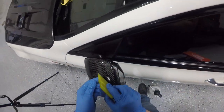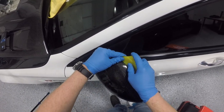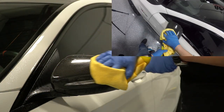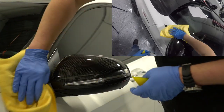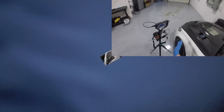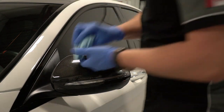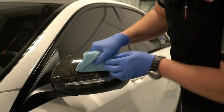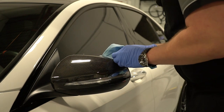There's a little finger in there that I didn't like — there we go. I'll take the microfiber and dry off the top side. With the shop towel, I'll take the squeegee, fold it in half — this allows any moisture under the film around the edges to get absorbed by the shop towel. Hold it there for a few seconds and that'll seal down the edge.